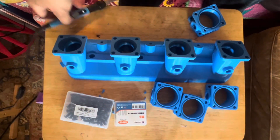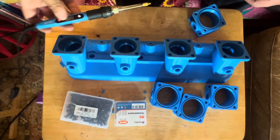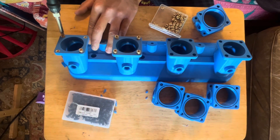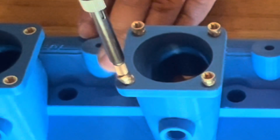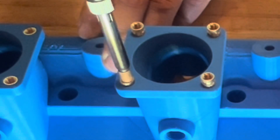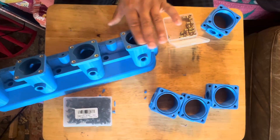Here I am the next day, and my first print had finished up, so we began assembly. I'm using this soldering iron to heat-set some brass threaded inserts into the plastic intake. It basically heats the brass inserts up so that they melt into the plastic. I was a little skeptical at first as to how strong this would be, but after trying it for the first time I'm quite impressed at its strength. After installing all the brass inserts, I began assembling the throttle bodies.